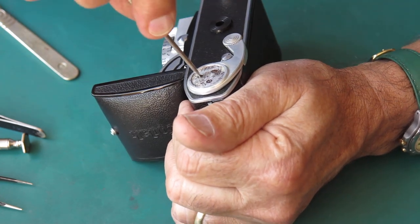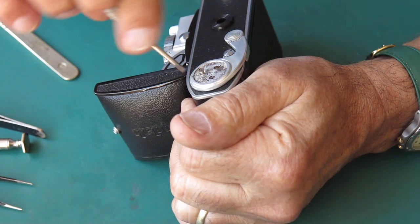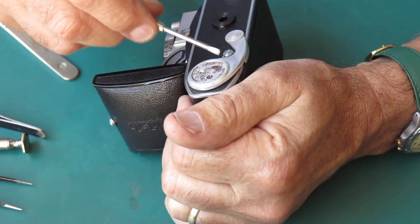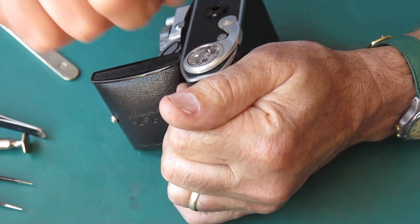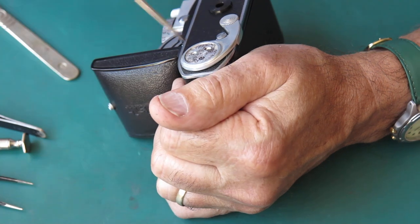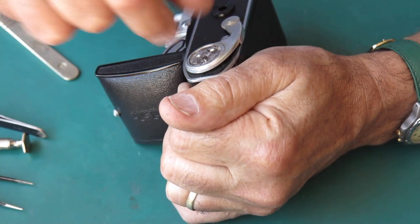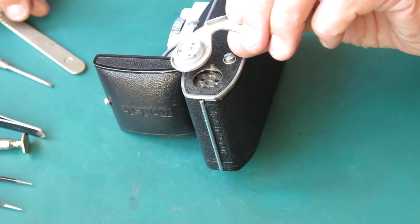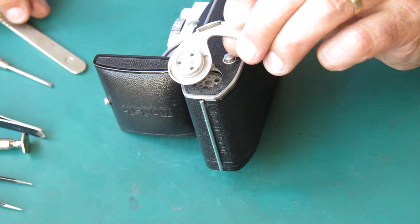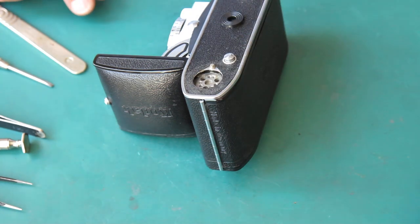Just checking the state of that lever, making sure that the disc on the bottom of the film advance is riveted firmly, since I had a great deal of strife with a Retina III Big C not that long ago, where that was not firmly riveted and it wasn't obvious it was loose. Alright, so that's that lever off,